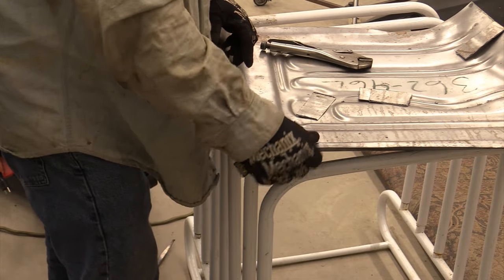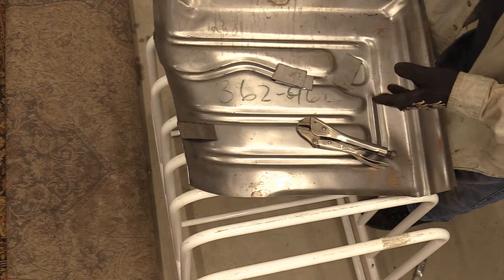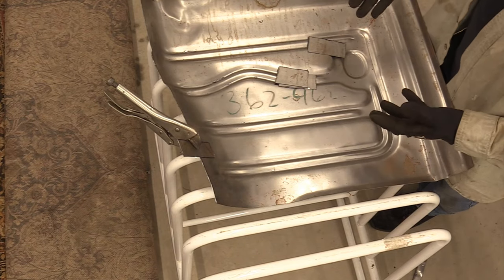Always dress your edges. I know it seems kind of silly since you're going to be welding it, but when you're moving this panel around inside the car even with gloves on and a long sleeve shirt you're likely to get cut with some of these sharp fold-out edges. Sometimes I'll even come back through here and chase it with the grinding wheel or cutoff wheel, simply because it won't come up a lot of times with a deburring tool.